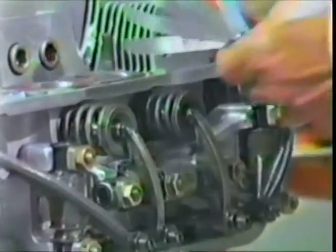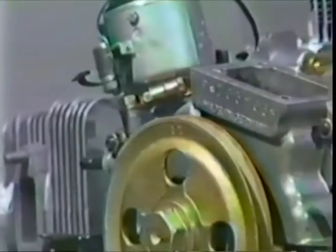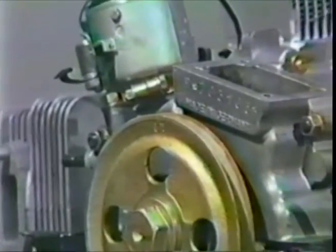Okay, now we're going to see just how well the maestro did by his calibrated arm. You get out feeler gauges that span the range in 1/1000th increments from 4 to 8, so that's 4, 5, 6, 7, 8 thousandths. You make sure it's top dead center on number 1. The OT mark should be up. There should be valve gap on number 1 cylinder, which there is.